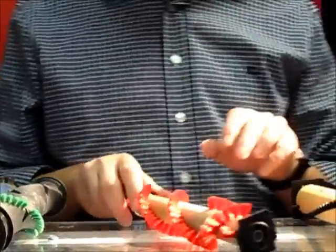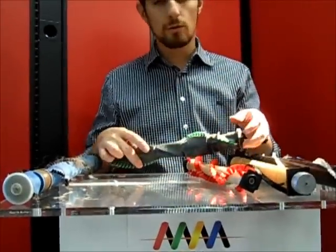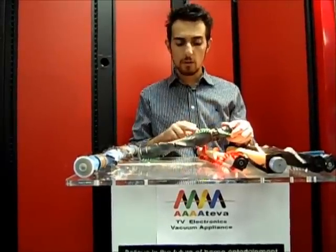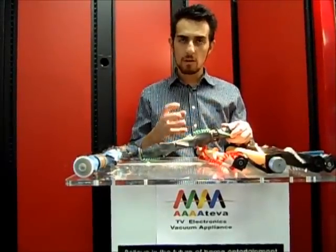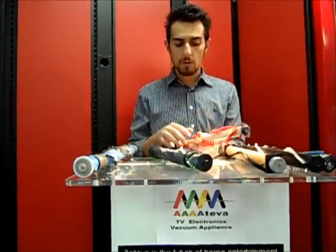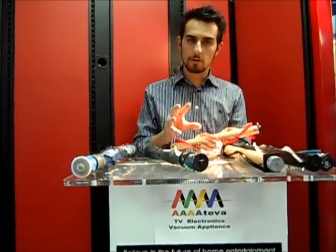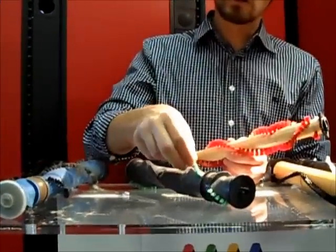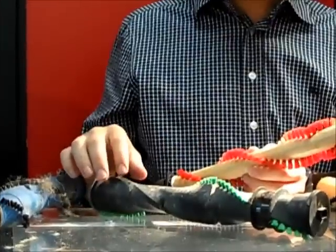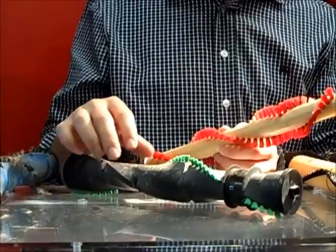We are also going to discuss the differences in brush rollers. Another way to tell that a brush roller has been worn out is you'll notice the bristles get shorter — they don't comb as well and they don't clean the carpet as well as a new brush. Notice how much longer and wider these bristles are in their stance versus a worn brush where they get shorter, thinner, more brittle, and actually start breaking off or wearing down due to friction.